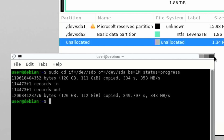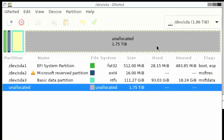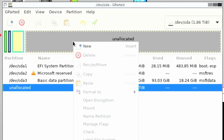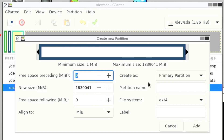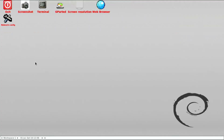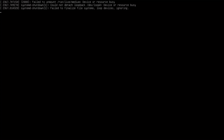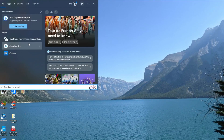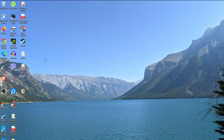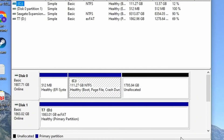Once the process is done, restart GParted. If you get a message, click Fix and make the correction your system requires, then apply all operations. Now we can exit GParted. Shut down the machine and reboot without the USB drive. With the old 120GB SSD removed, your machine should boot normally into Windows. On checking disk management, we now see we are using the 2TB SSD to boot into Windows. It seems I was not able to apply the fix in GParted, but no worries — Windows did boot up properly and we can easily fix this in Windows with disk management.